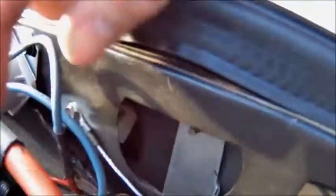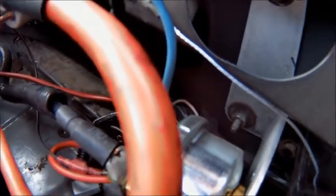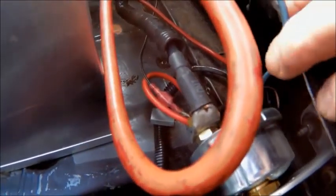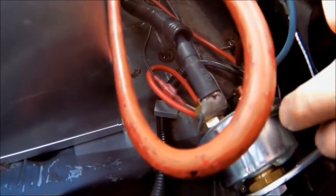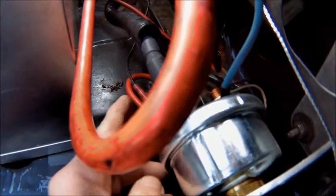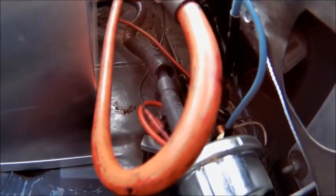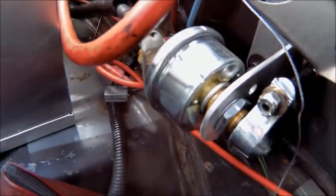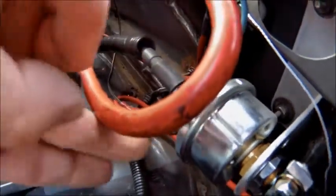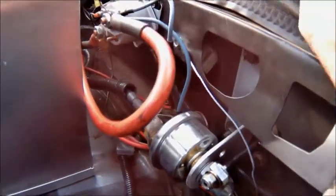How I have that hooked up is I have a wire that comes off of the kill switch and runs up here to the starter solenoid right here. And this is a fusible link, and this applies — this is what's giving power to the switch. So that way when the switch is on, this heavy gauge wire that runs to the front of the car — that's how the power is getting to the front of the car from the back of the car. When I turn it on — see, dome light's on. When I hit the switch, it kills the power, so there's no power coming out to this other post. Therefore, this wire here, electrically, is dead. It's not seeing any power at all. That's how that works.